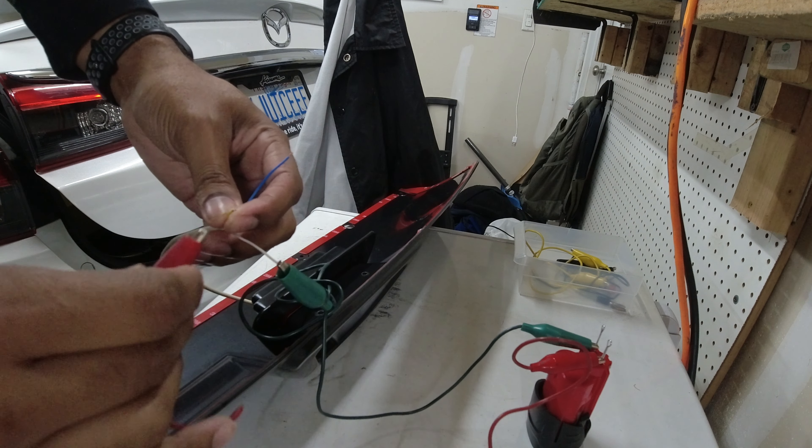We need to figure out which wire does what. If his wires are the same color as mine on the driver's side, then the white plug with the red and black wire should be the brake light, and then the black plug with the pink and black wire should be the running lights.